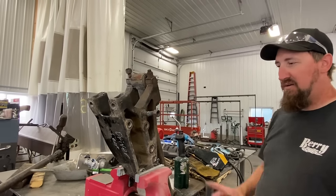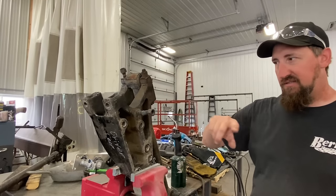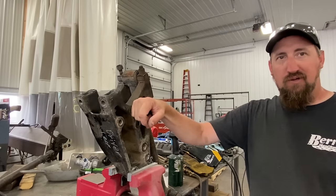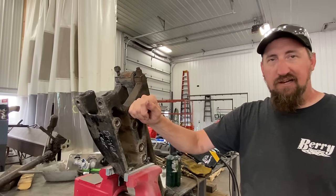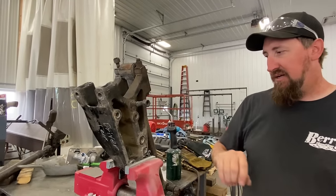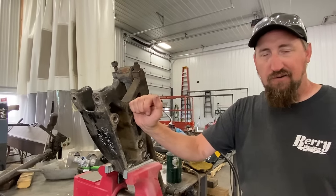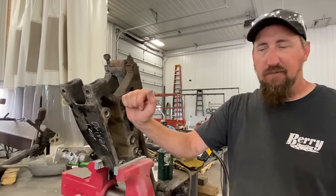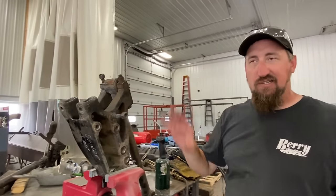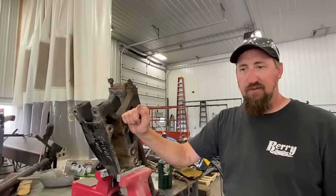Anyways. So I'm going to show you guys how to get these bolts out. It's in these two. I've had to take this whole assembly to a machine shop once in a while, but we're going to try and get them out ourselves first. Air chisel or whatever, but this is just the nature of a flex air suspension or a Kenworth AG380. They're both the same. They've got the horseshoe-looking leaf spring. This happens. So when you're stretching frames and stuff, if it's got this suspension, be ready for some work. It's just extra work, but now's the time.